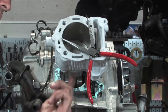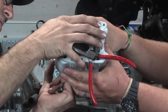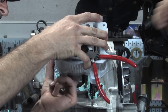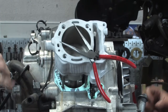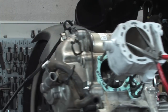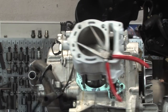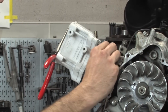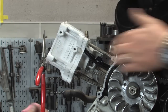bind up. I got the wrist pin right here, ready to go through the connecting rod, small end. And you gotta sometimes wiggle it because the piston is not perfectly parallel. Let's spin this thing real quick. So you can kind of see from the camera what's going on. Actually, we'll spin this way first. Show it like that. Cam chain. See that? And it's kind of going right there. And as we slide on, you gotta watch that part carefully.